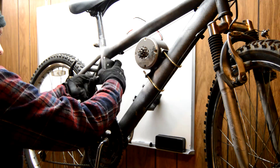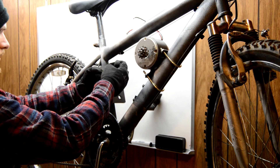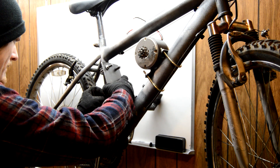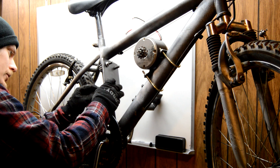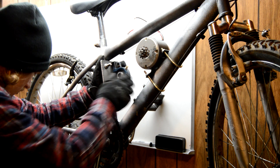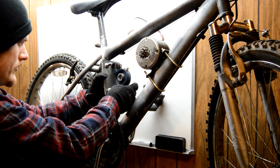I think I'm going to have to start with just one though. I'll put this nut on here just to keep it from falling off, and we'll do the same for the bottom. These are inch and a half muffler clamps — pretty much just the smallest ones I could find because it's a pretty small bike. Then I'll go ahead and put the other one on and get that side going. I just realized I'm going to have to flip-flop these so I can tighten the set screws, so let's go ahead and do that right away.